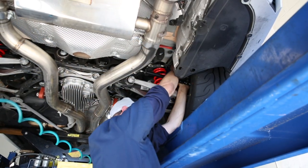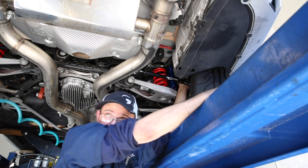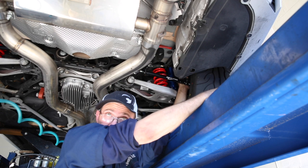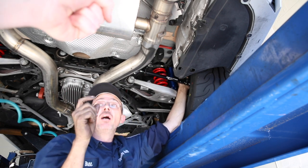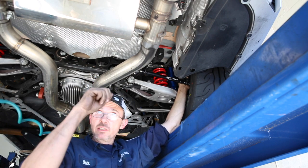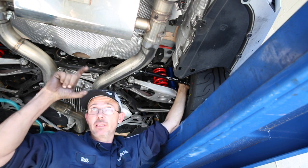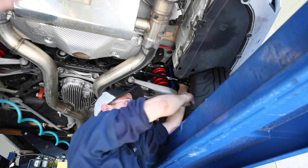So once we put them back on, they don't really need to be super tight. Is that the idea? They just sit in there? Or do we torque the nuts against each other? Correct. Once they're in there and they're the correct length, then we'll tighten the jam nuts so that it keeps the length. Gotcha. But it can still pivot around, right?